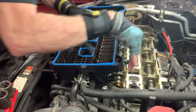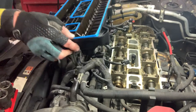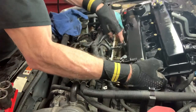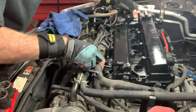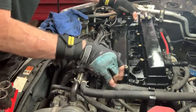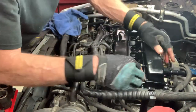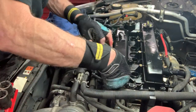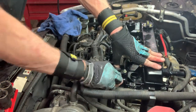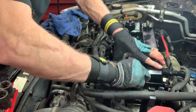That's all there is to putting all the gaskets on and cleaning everything. Let's drop that valve cover right back on there the way we took it off, wires out of the way. Get all these bolts started. Make sure you don't have anything underneath the valve cover. Get them all lined up and started by hand — you can run a little socket on with your hand.